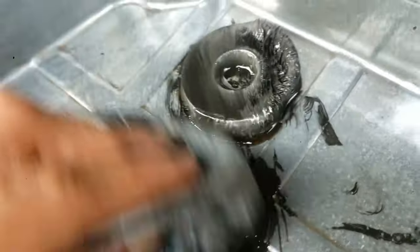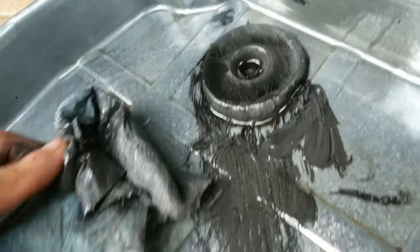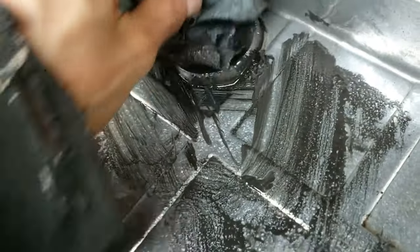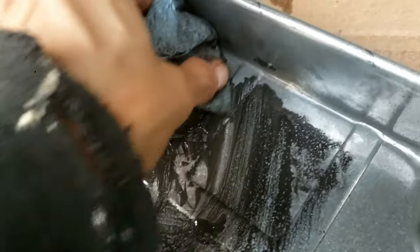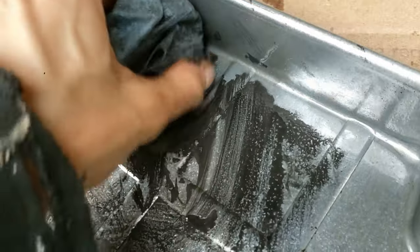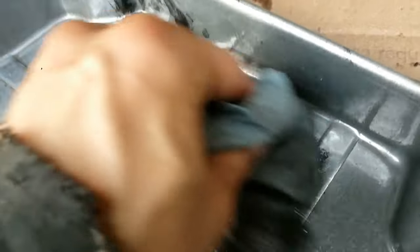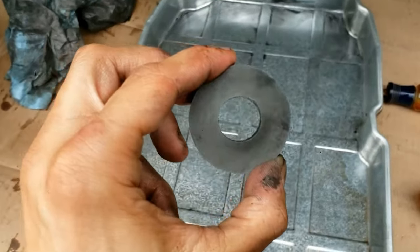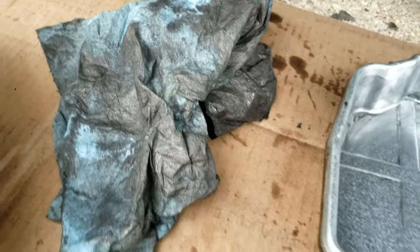There's a magnet in the pan — look at how dirty it is. That gray shiny sludge is the clutch material, and this transmission oil has clearly never been changed. Here's how the magnet looks once it's been cleaned — there's a significant amount of buildup.